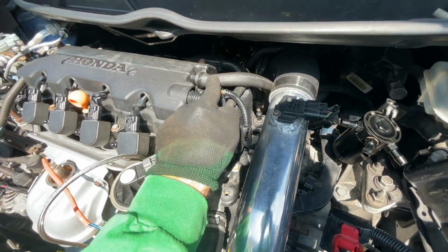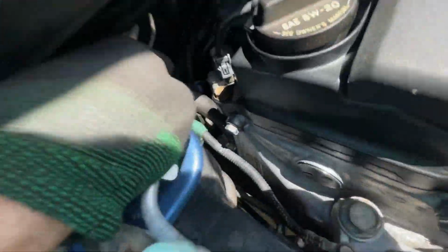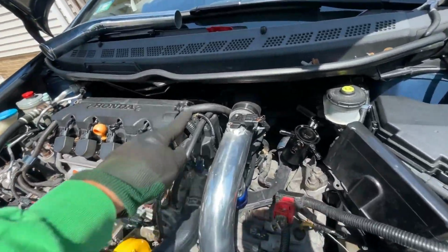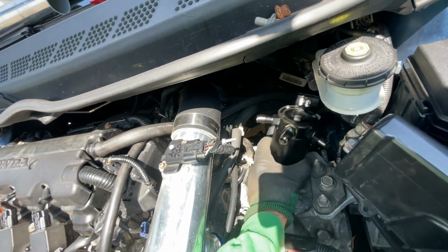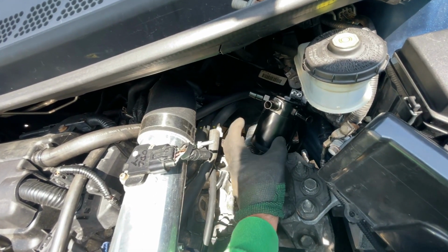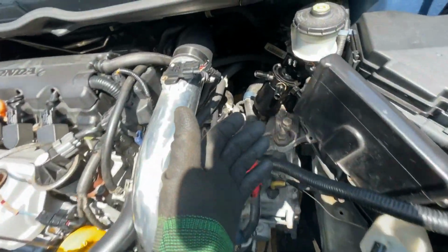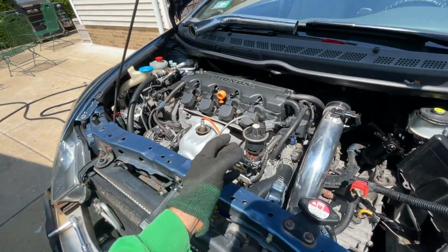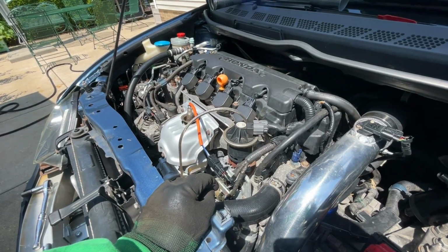Originally I was venting this all the way down under the car, and I was also venting the positive crankcase ventilation, just a straight through barb fitting venting under the car. What we're gonna do here is take that one into one port and this one into another port, so we're dumping in all the gases and oil that's gonna catch itself right over here in the oil catch can. Then from the middle port, we're gonna get a nice vacuum source from the intake. So as we're driving, in full boost, all that vacuum getting sucked in from the intake is gonna be pulling out all the combustion gases in the cylinders, which is gonna help improve efficiency. It's gonna help excrete the gasoline and the vapors in the engine,